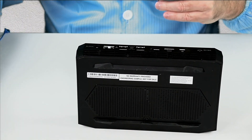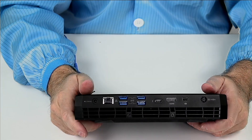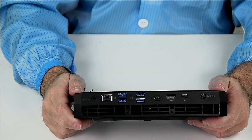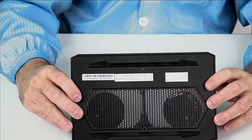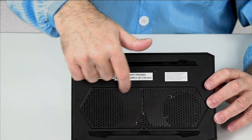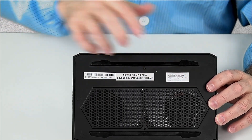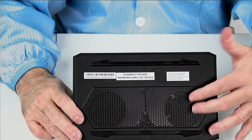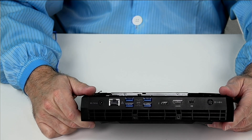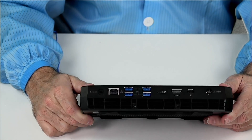If you are just trying to clean your blowers and get the dust out of your system, it's sufficient to simply take a can of compressed air and spray through these vents. This will clean out the cooling fins — the fin array — which is in there. On the bottom, you can see the blowers and they've got lots of open ventilation. Just take your can and blow all the dust out. You can actually shoot it down into the blades of the blower until the blower is spinning, because then the air will be hitting each of those blades and cleaning any dust out of them. Clean the two blowers and the fin array with compressed air. How dusty your environment is will determine how often you need to do this. Any time you get visible dust, or you notice your temps are increasing, go blow that dust out.